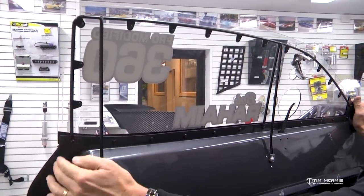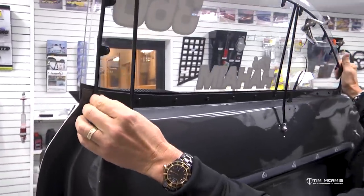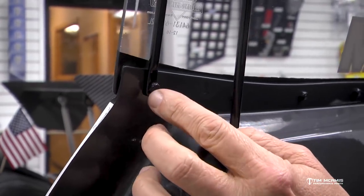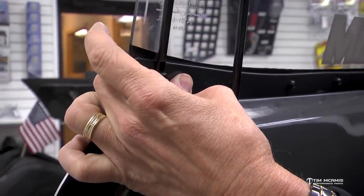This part here is going to be long — we're going to give you some extra tubing here. If you look at this, you can see where we've flattened it out in a press. We just put it in our hydraulic press and flatten the end of this and then round it off. You can cut this off to your desired length and align it with the end screw hole. This hole goes through the window and through the window frame, attaching it to the lip at the top of the door.